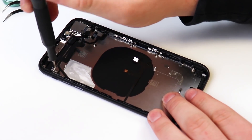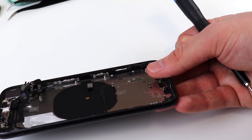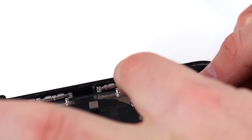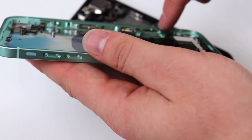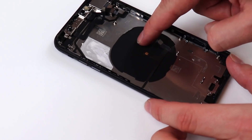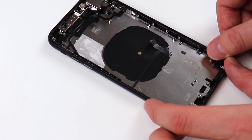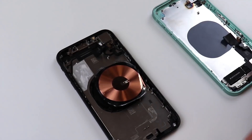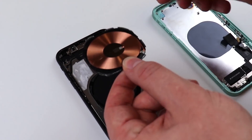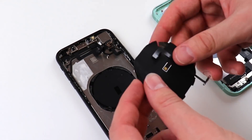Now that we have our battery removed, we can begin to unscrew all the other components off the housing. We also need to transfer these side panels to our other housing. We got most of the side panels installed. Now we have to remove our wireless charger coil, which proves to be very difficult to transfer over. Hopefully we don't break it. We got it removed — I think it should still work, but there's no way to really know until we test it. For now, we'll just install it.